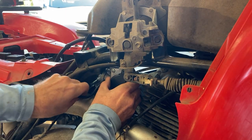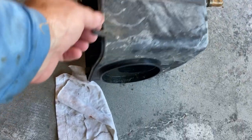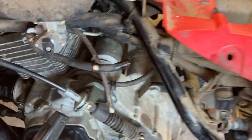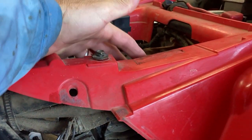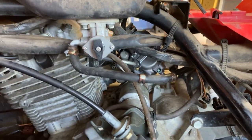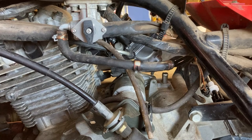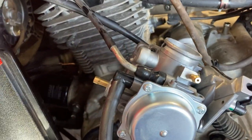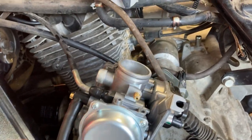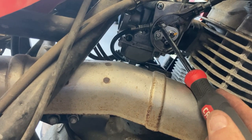The idle adjustment cable goes under the carburetor; throttle cable linkage is right here, that's fairly simple. I really didn't want to do it, but I took the air box out. The rubber line goes to the back of the carburetor and to the air box. Removing that air box — which used to go right here — gives me a ton more room to work from the back and from the side. I didn't want to remove it because there's a bolt that goes in right behind there that's going to be so hard to put back in. But I couldn't get the choke cable into the carburetor at the right angle, so I took the air box off. It'll give me a chance to clean it and clean out the drain as well. The choke cable is on right there, and I had to bring the carburetor all the way through the bike because there's no other angle I could put it on.